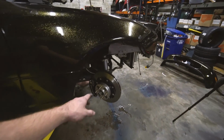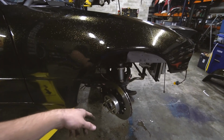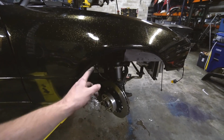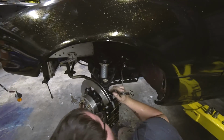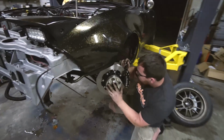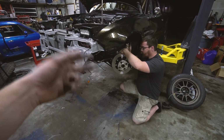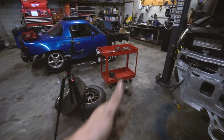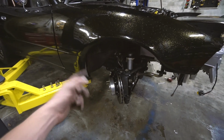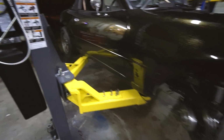Thought that we weren't going to be able to install them because I didn't think the lines that come with the kit were going to be long enough, because on a drift car you need extended lines, but they are long enough. They're just long enough. So at full lock, they just get tensioned. It's literally like if they were half an inch shorter, it wouldn't work. But I thought I was going to have to go find different lines and adapter fittings, etc. But the stock ones work. Rad. So Ben's finishing up his side. Need to install brake pads, put the wheels back on, work on the handbrake.